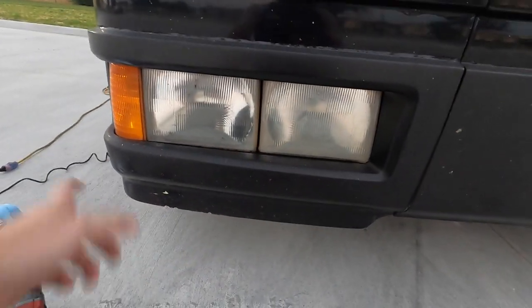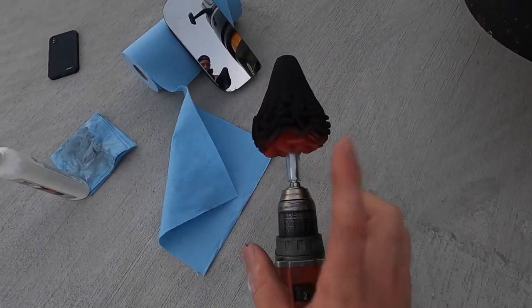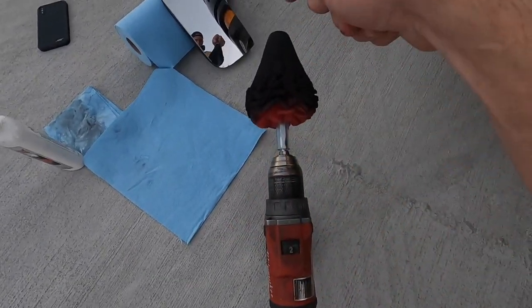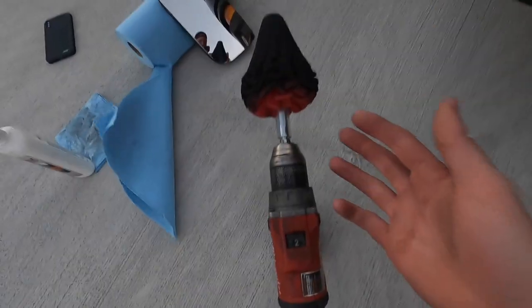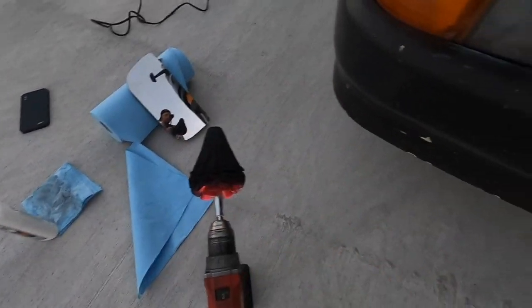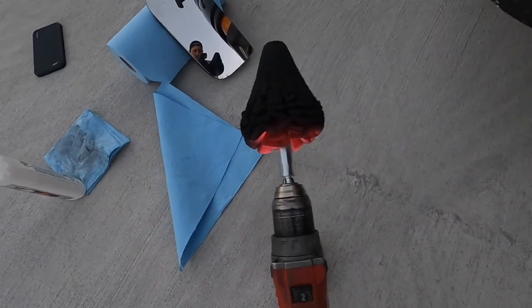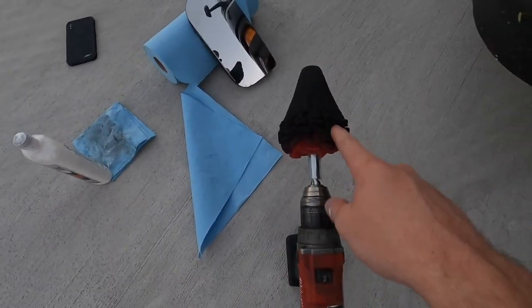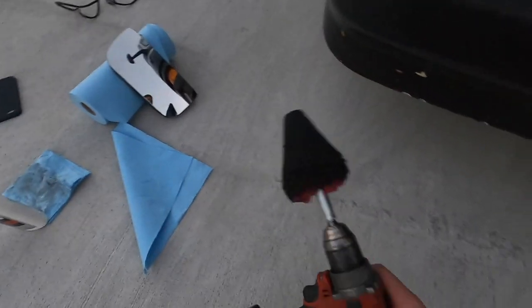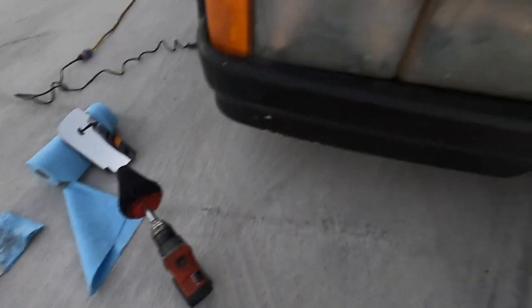Insane. So I'm gonna hit this other one, go a couple more over here, get a little better. Something to note here, when you're working with the cone, is that the area that you're against with the tip is not going to be as deep of a polish as the base, because the speed from here is not the same as here. This is going to get much more material coming over the contact patch. You know, like a pulley or a bigger tire, you're going to go faster. The speed from the shaft is going to be multiplied by the bigger size of this foam ball. So the big ball works even better for stuff like wheels. But in tight areas, all you can use is a tiny part, so is what it is.